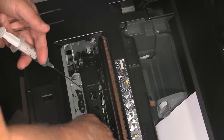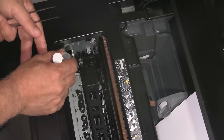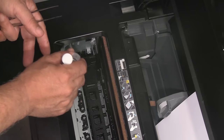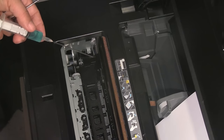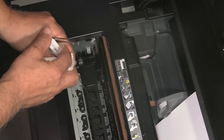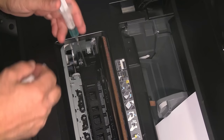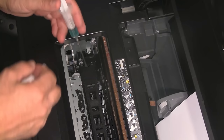I never print borderless, so I never get any overspray in these areas. However, on the far left, some printers have a sponge that acts as a wiper as well. The printer will make, say, six passes, and then on the seventh or eighth pass it will go all the way to the left side, and the surface of the printhead will actually wipe itself on this area. I will demonstrate by depositing some Windex here, blotting it — it's clean. I'll do the same on this other side and blot it, and you can see that there is ink there.